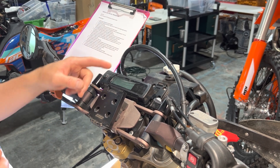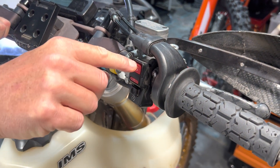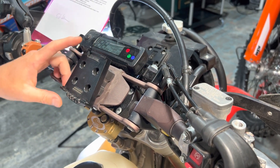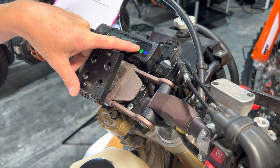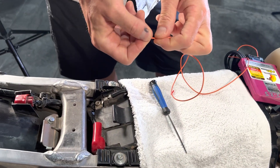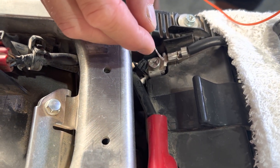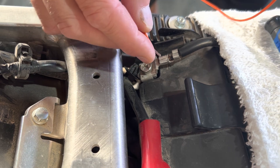Make sure the key is in the off position and the master run switch is in the engine-off position. From there, turn on the key and note that the check engine light is off. At this point, come back down to this trigger wire — this is basically our TPS programming trigger wire. At various times we're going to touch that to the battery negative, and that will put our ECU into capture mode — essentially program mode for the TPS.